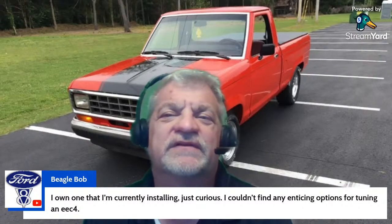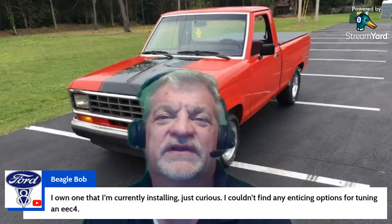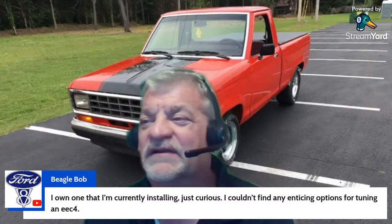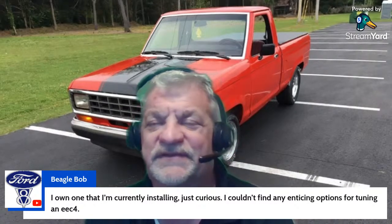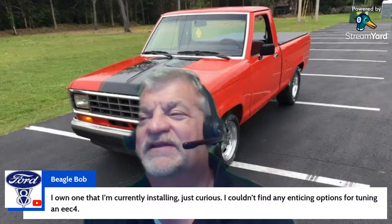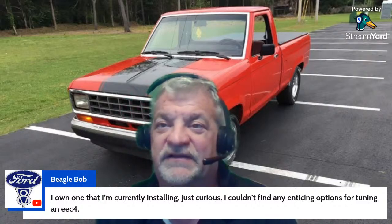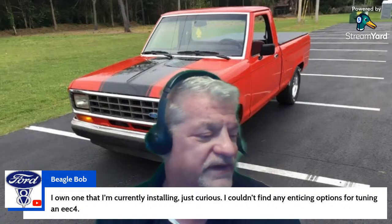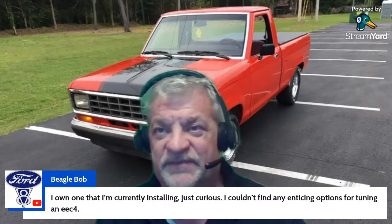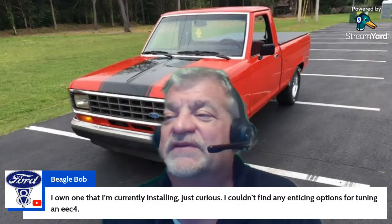I own one that I'm currently installing. Curious, I couldn't find any enticing options for tuning an EEC4. Yeah, for an EEC4, you just replace it with a standalone, like you're doing, or some kind of piggyback chip. But that's a good option, the Megasquirt, and it's cheaper than putting a Holley on it, really, for the same kind of function. If you know how to do it, or you got a guy that knows how to do it, it's a very cheap option because you can build it yourself. I don't know if they still sell the build-it-yourself kits. I haven't looked at a Megasquirt in a while.